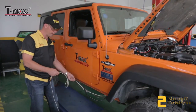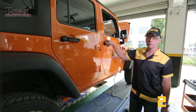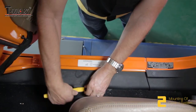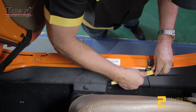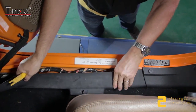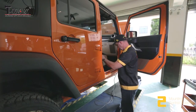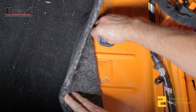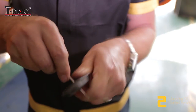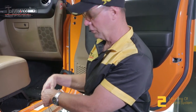After we've run the wires through, we can move on to the next step. We need to remove the carpet cover from the passenger side, then pull back the carpet so we can take out the seal plug to push the cable through. We need to stab a hole in the seal plug to insert the wires and thread the cable through the seal plug.